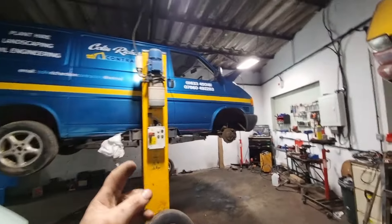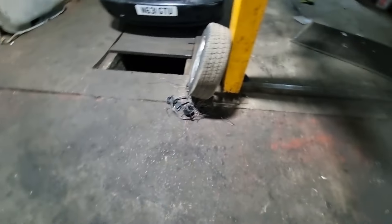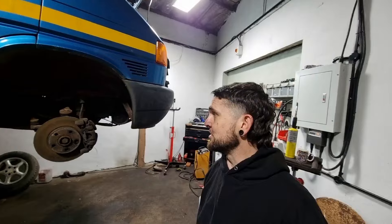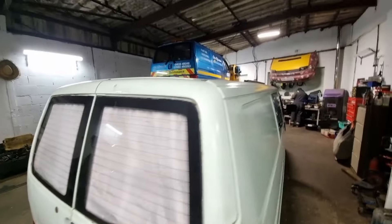John attacked the abandoned van - fair play to him, he managed to pull out all of the crappy old immobiliser electrics. He did have to put a new starter motor on because the one in there had fried itself. After eight years of not running, she then fired into life. He's got a lot of other stuff to do - everywhere's crusty, the brakes, ball joints, steering arms, suspension. I think he said it needs springs. Everything needs a little fettle, but nothing he can't manage. I'm going to make coffee, give Die a hand, and the next time you see me I'll be driving this old girl back home.